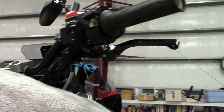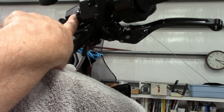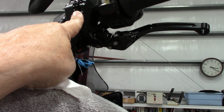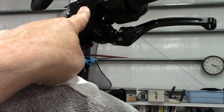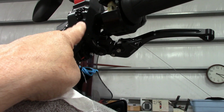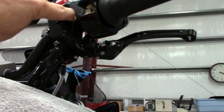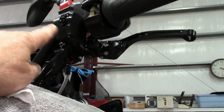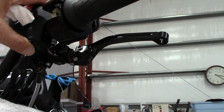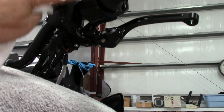Hey guys, well, the brake perch is right into the radius. It's kind of as far as it can go and backed out just a smidgen. The start run switch, I went ahead and ground off the little tip that goes in the bars. You don't need it. Just don't open it up on the radius. Just make it flush, get it close, and then use a little round file real carefully, because my bars are still a little bigger than the switch opening.